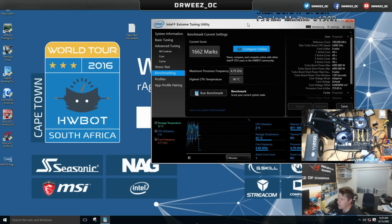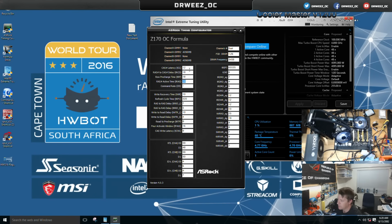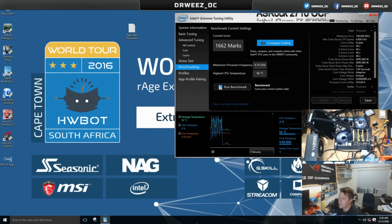Alright. So in a nutshell, what I changed there was basically set much looser timings in the BIOS. I just used the 3600 profile, but changed the megahertz down to 3466. The timings were straight from the profile again. I didn't use anything special that I've done, and I just changed the megahertz down.